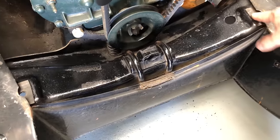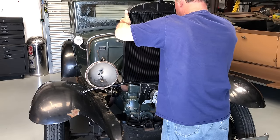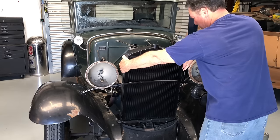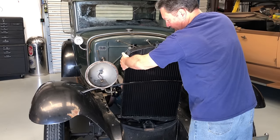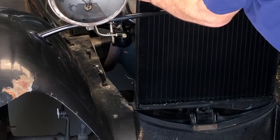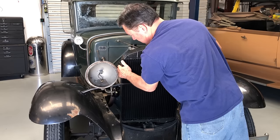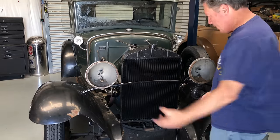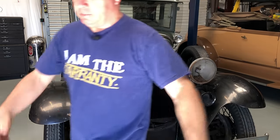Good morning — it is a great new day. Time to get back on Gandalf the Green Coupe. We've got to get this re-cored radiator in the car, maybe even get it buttoned up today. I glued these two rubber pads down last night with some silicone — they are in place now, not going to move around. It'll make it way easier to put the new radiator in. Time to put the freshly re-cored radiator in. I'm going to carefully lower this into position, avoiding the fan and everything behind it that's pointy. I'm going to put the tab on the driver's side in place first, just wiggle that in, then skew the radiator over slightly towards the back of the car, slide the hitchhiker side in, and carefully jiggle to line the holes up.